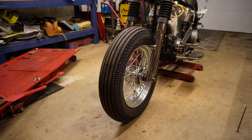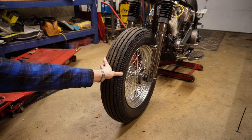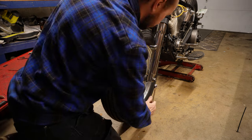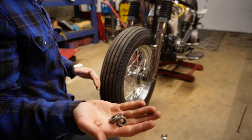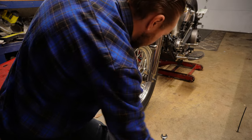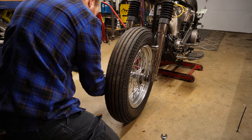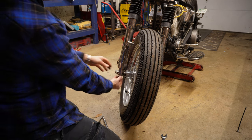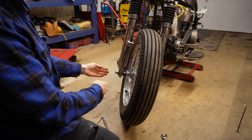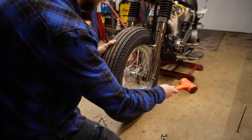We're going to pop this front wheel off. The bike is jacked up just enough so the wheel has tension removed — it's still touching the ground, but I can swivel it back and forth by just touching the tire. There's a lock washer and a washer on here, so make sure you save all that hardware. Then we loosen the pinch bolts with the half-inch socket. You don't have to take these off completely — just loosen them so the axle can move. If you try to knock the axle out without loosening the pinch bolts, it won't budge.